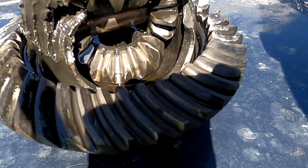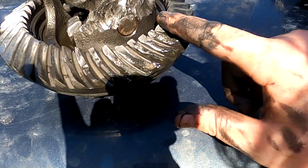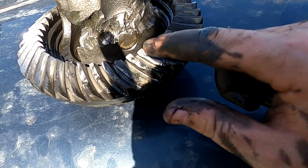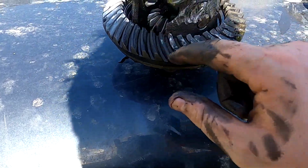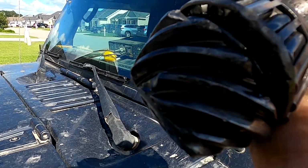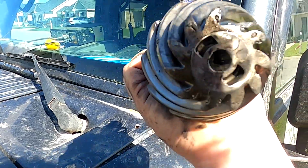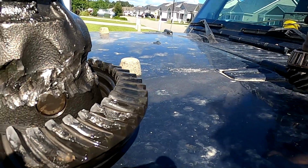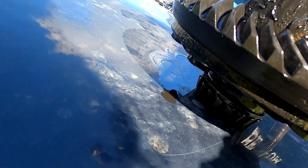These gears all look okay. Yeah, just like this one spot is where it failed, and it took some chunks out. Took that one deep. And then there's just that one spot, well, two spots on the pinion here. Oh no, it's more than that. The pinion pushed forward apparently, and when it pushed forward, it knocked all this the wrong way.